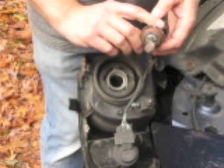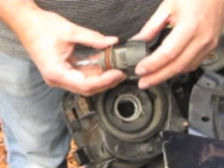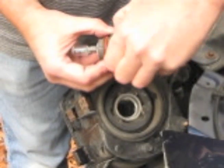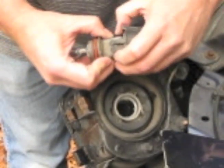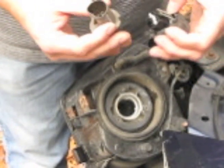We can lift that right out. Once you have removed the retaining ring, there's a little connector here that holds the bulb in its socket. Carefully pull that up and pull the bulb forward. There's the socket that it goes right into.